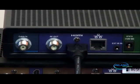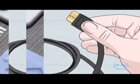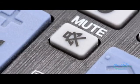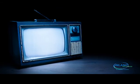If you are having issues with the sound on your TV and you are getting no sound or low volume, please check your HDMI cord as it may not be plugged in correctly or you might need to replace your HDMI cord. There also could be additional issues like the TV is muted or the sound system on your TV is no longer working properly, or it could be your box.